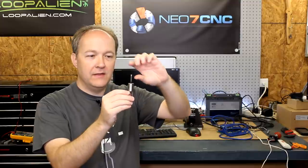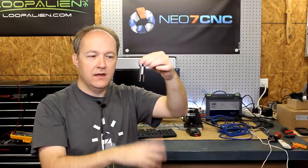The little impact press I got off eBay — I want to say it's 500 pounds strike force — it's one of the smallest ones you can get, and you can dial that back. People use it for jewelry, all kinds of stuff, and it does work. But this is the largest size tool the collet on this impact press will hold. By the time I've got this big hunk of steel hanging out in the collet plus a hunk of hardened steel stamp hanging out, there was so much weight that it messed up the strike — it would bounce and actually double strike. At that point I'm like, waste of time, but lesson learned. You can't win them all.